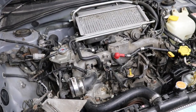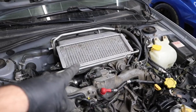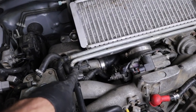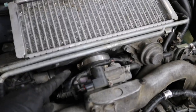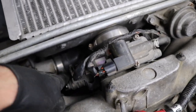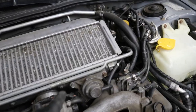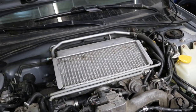Now we're going to clear up space at the top of the engine bay by pulling off the intercooler. Pull two 12 mils, one on each side of the intercooler. Pop off the PCV hoses from the crossover pipe at three spots. Then pull two hose clamps — one on the throttle body coupler and one on the turbo outlet hose — using a flat head or 8 mil socket. Take the two 12 mils out on the bypass valve and the intercooler should come right off.